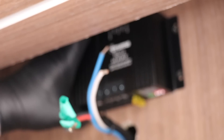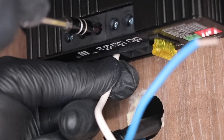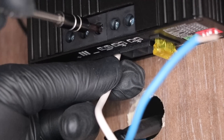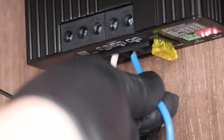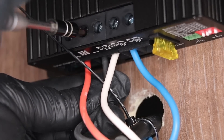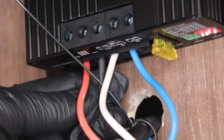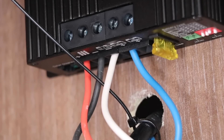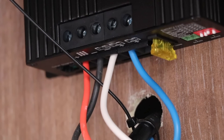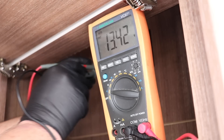I've fixed the controller to the caravan — I can reuse two of the screw holes from the old controller, which makes a nice neat installation. Then it's just a case of reattaching the wires for the battery. The order is slightly different from the old controller, so I'm double-checking that they all go into the correct position. Once the battery terminals are tight, I screw the panel wires in and again check for polarity. A visual check here to make sure no stray wires are sticking out — you could also use a continuity check to make sure there are no shorts — but I'm happy with my work, so I'm ready to recommission the battery.